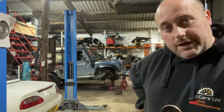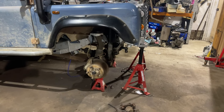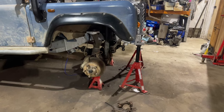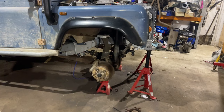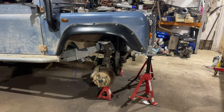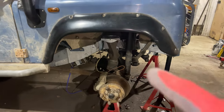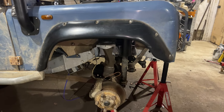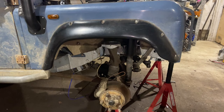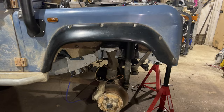So what I've done so far: I've lifted the chassis onto the large axle stands and lowered the axle onto small axle stands to test the droop. That is full droop of the shocks, so I can measure where I'm going to have my suspension limiting straps — because obviously if a shock breaks and we twist, we're going to pull an airbag. So we need some limiting straps on there just to be on the safe side. I've measured those, so we've got places for those.